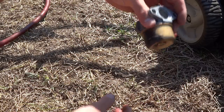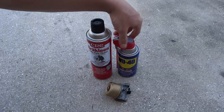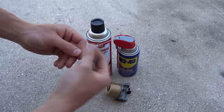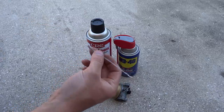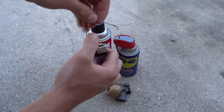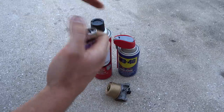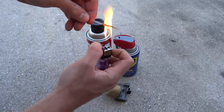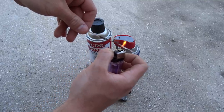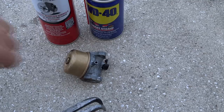Not stink up the house too much. What you will need is some brake cleaner — you can get it at Discount, AutoZone, or Walmart — and some WD-40, a carburetor, a twisty tie, bread ties, and a lighter. What you're going to do is you're going to light this bread tie. Now this probably looks like a crack thing because it gets super high, but we're just going to burn off all the plastic, because we're going to use this to clean out the ports in the carburetor.